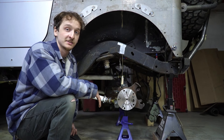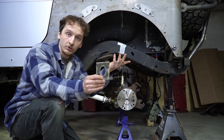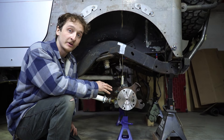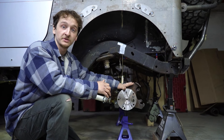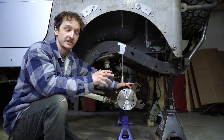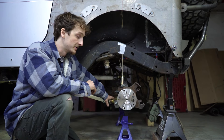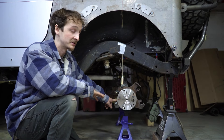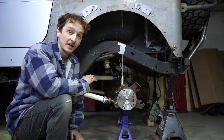Once the axle was completely centered, we made upper link mounts on top of the truss, cutting those brackets on the CNC. We still need to add a top plate and some rear plates. We found out the exact degrees they had to be and tacked them into place. On a triangulated setup — whether single or double — you need at least 40 degrees of triangulation to keep the rear axle centered. A triangulated setup eliminates the need for a track bar, which is nice because the track bar is often one of the limiting factors in suspension travel. For the lower brackets, we used ones from Barnes4WheelDrive.com — they're 20-degree brackets, kicked in slightly to allow for the correct triangulation.